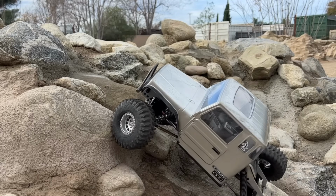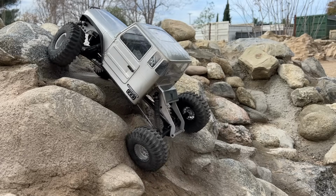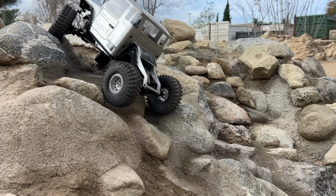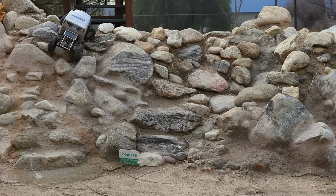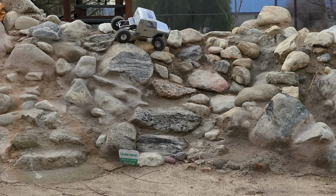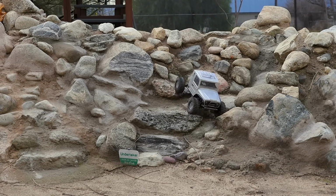So instead what I do is I have all of the bushings from baseline. I put bearings in him gradually over time. Whenever he's being serviced for something, I just took bushings out and put bearings in because bearings are cheap. So I have all those bushings, and a conventional housing, like what used to be in him, a regular Element housing, runs a 5x10 on the inside, which is way too small for an inner pinion carrier bearing. So I just put a bushing in it. All of my Element axle rigs are running a bronze oil bushing for the pinion carrier. Try to blow one of those up. It's not a thing that happens.